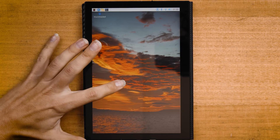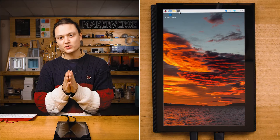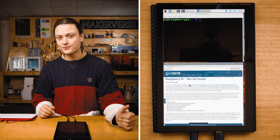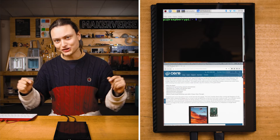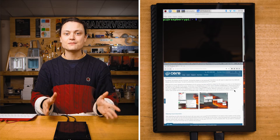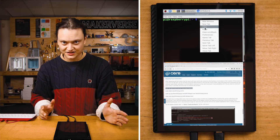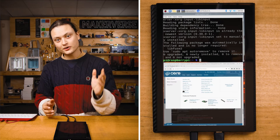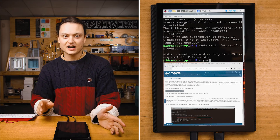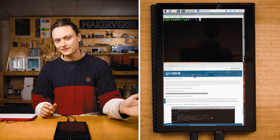After rebooting, you'll notice the touch input now needs to be rotated as the hardware does not register the new screen orientation. To fix this, open up the terminal using the black button on the top left of the screen. Then open the full article for this guide linked below and find the 'Adjusting Touch Orientation' section. Copy and paste each command into the terminal, pressing Enter and allowing each to finish before moving to the next. If prompted with 'Do you want to continue?' press Y then Enter. This setup works for any Raspberry Pi model, so some commands may note that a folder already exists — don't worry, just continue.